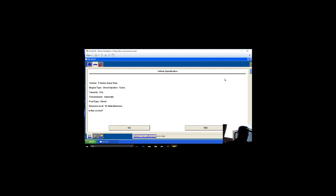I'm pretty frustrated because I want to figure out what's going on with my truck. In a previous video I found that the EGR valve was sticky — the EGR itself was fairly clean but the valve wasn't going all the way back and was very sluggish. I cleaned it up and it's opening and closing well now, drove about 10–15 miles, but it still hasn't passed the EGR readiness monitor. Back to square one.